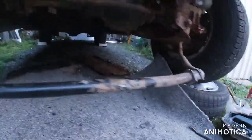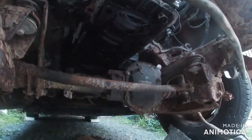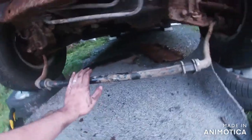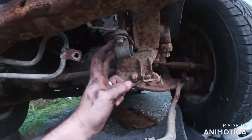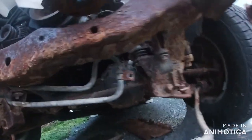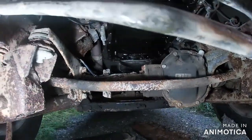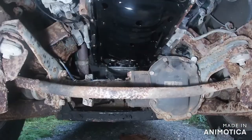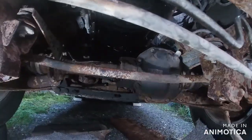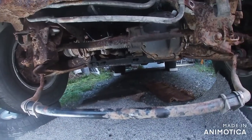So I've got the sump off. To get that off, there are four bolts on the front, about eight down either side. And if you undo the anti-roll bar — just two bolts, two on each side — and then the bolts at the back for the sump are a good nightmare to get off. Then you just have to loosen that for the sump to fall out while everything's still attached to the car.